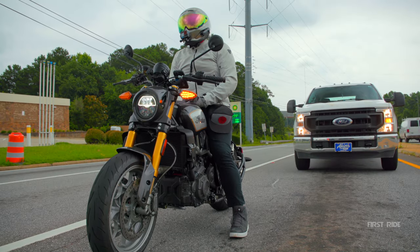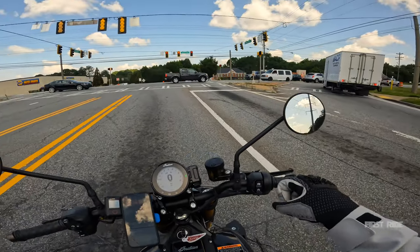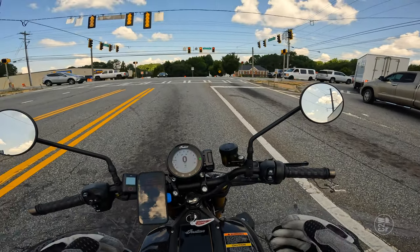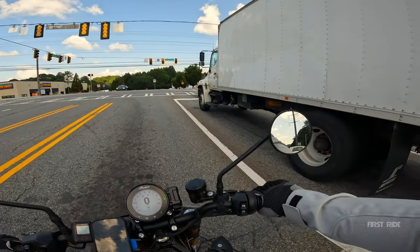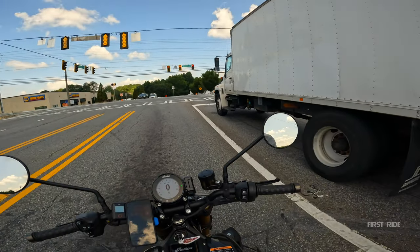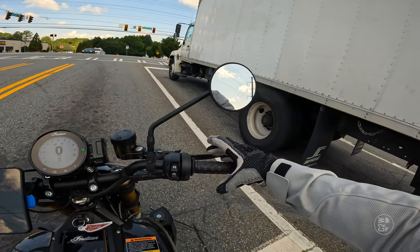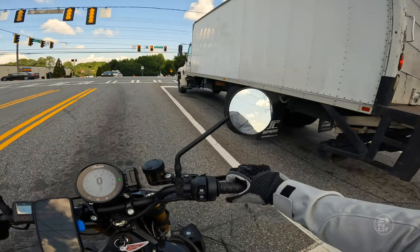I will maintain a constant throttle, right? And I do this on all motorcycles, so it's not like I don't know what I'm doing. I'm holding a constant throttle, and if I sit there for a second and I keep the same RPM, same gearing, I don't shift, the bike will start doing this oscillating forward. That oscillation will lead to my body doing that, which leads to my arm doing that, and then I start oscillating the throttle more, and it just gets so unsettled. The way I end up riding this motorcycle, which I've literally never done on any other motorcycle, is I have to put my hand on the bar end as a stability factor, and I end up using the throttle with these two fingers and my thumb.